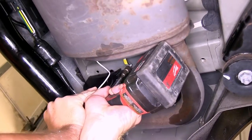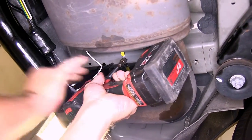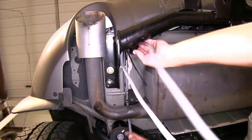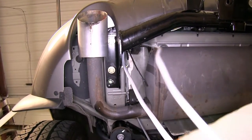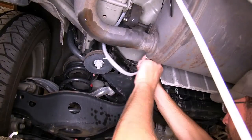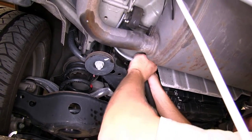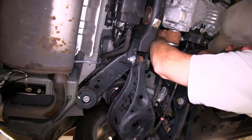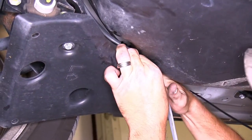The ground will need to be secured directly to the vehicle frame using the self-tapping screw provided with our install kit. With that done, we'll continue routing the gray duplex cable up to the front of the vehicle. Keep in mind when routing your wires, stay away from any moving components such as steering or suspension, or excessive heat such as exhaust. Using some black zip ties as we go, we'll secure the wiring to the vehicle as necessary.